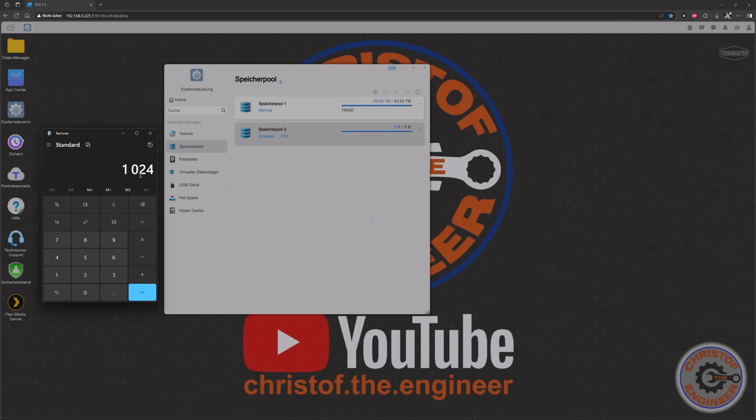How do you get to the 1024? It's not a metric system. In order to get a kilobyte, you do 2 to the power of 10, and then you get to 1024. But on disks, they calculate it differently, multiplied by 1000 each time. So from 1 byte, or at 1 kilobyte, I have to say at 1 kilobyte you already lose 24 bytes.